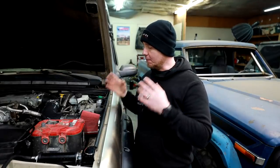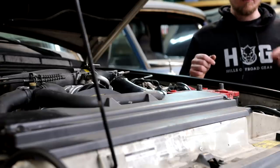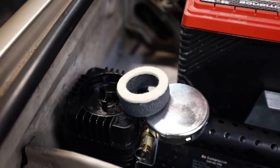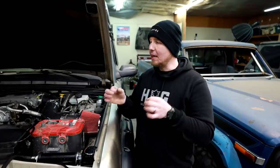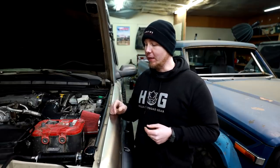Making it functional and making it look good is going to be a big challenge, but it's worth the time. I also want to integrate the two intakes for my two compressors, because these are going to suffer the same fate as this engine if they get a bunch of dirt in them. The foam filter that comes with these compressors I don't think is going to be great, so I'm going to adapt the air cleaners on these to be a remote mount style, run tubes into this air box so they also see some pre-filtering and an upgraded filter. This is going to start with me breaking out some thin gauge aluminum and all my metal shaping tools.